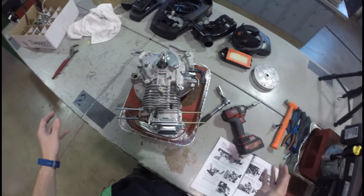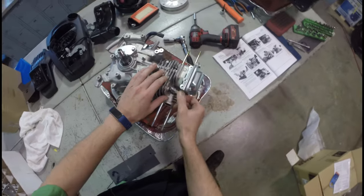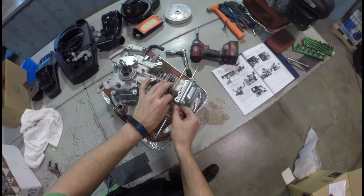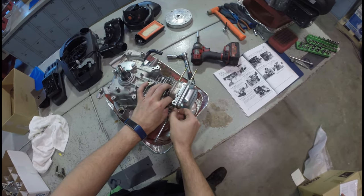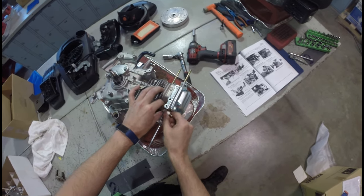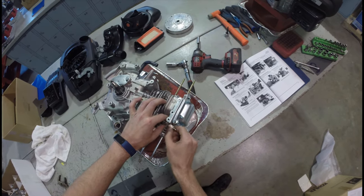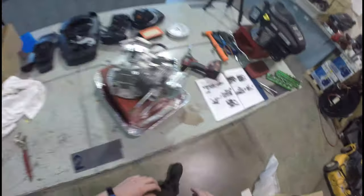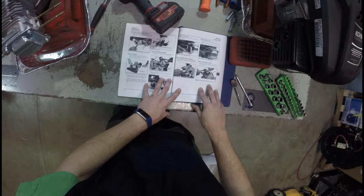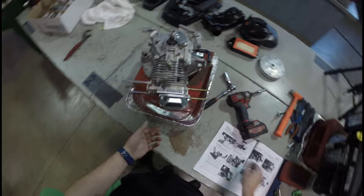I'm going to hold this down, be as careful as I can. I think it wanted me to remove that whole assembly — it just wanted me to remove the spring. I'm going to take this off at this point because I'm scared. Backtracking ever so slightly, being careful doing it — another 10. These are weird. You'll see in a moment what you have to be careful of with this. These two bolts are longer but they come with spacers. Keep an eye on these spacers — if you lose them you're not going to have a fun time. I jumped the gun — I'm sorry. Removing the valve cover. Four of these bolts here, we've got the 10 millimeter still.